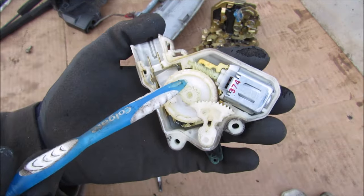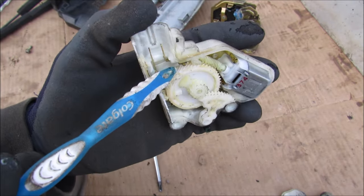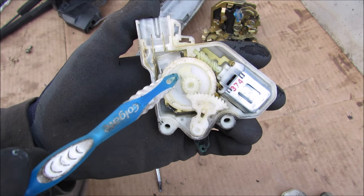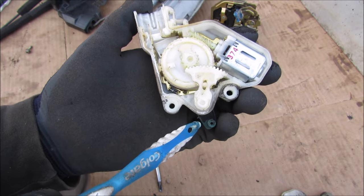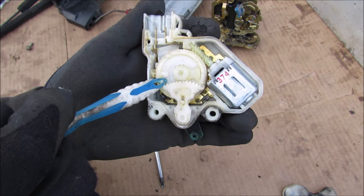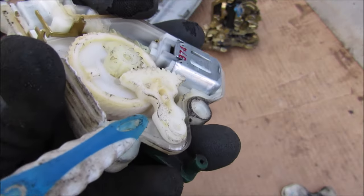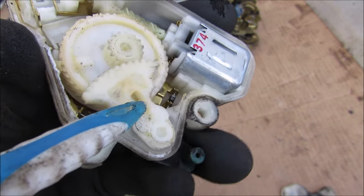Inside the actuator we have a standard 12-volt DC motor with a spiral gear that turns a helical gear. When the helical gear spins, a notch moves a tab on a smaller gear for further gear reduction, which moves a quarter gear that in turn moves the arm to lock or unlock the door. It's not a straight gear ratio - this allows extra free play so the door lock can be locked and unlocked manually. There's also a little arm inside that slides to create a cam-slider mechanism.